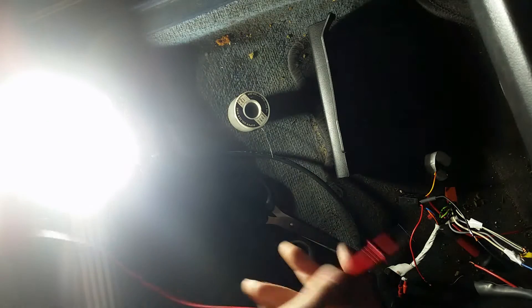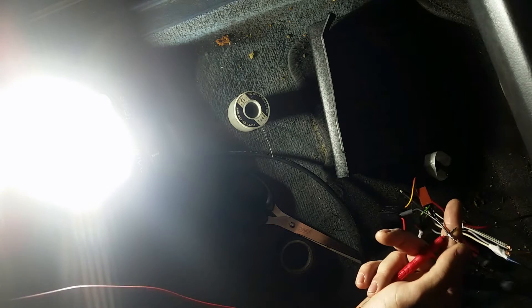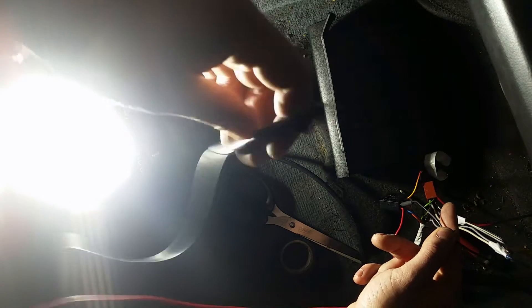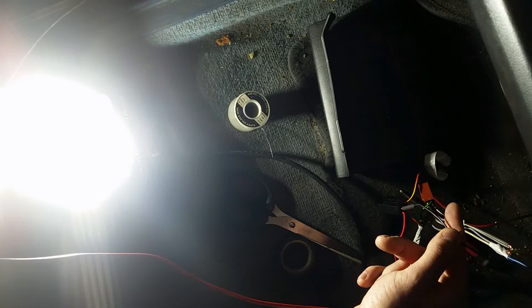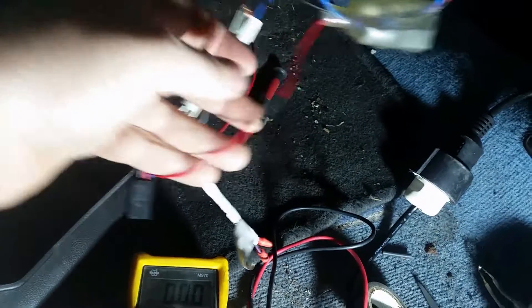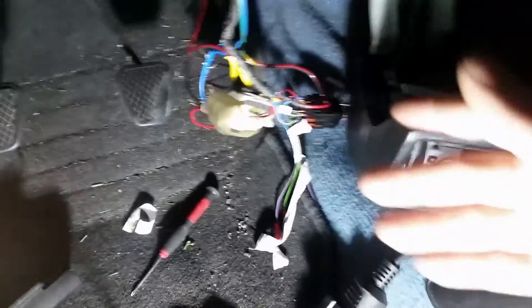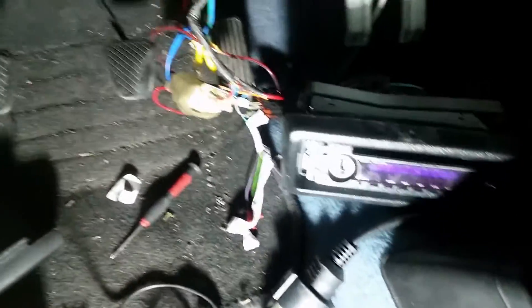Now it's time for me to solder everything up. I will not go into detail on how to do that — there's a separate video on how to solder and I'll post a link below. First up, I need to check if the ground is any good. I'm holding the probe to the ground wire and the other to the chassis — if it's correct there should be a beep. Perfect. Second one done. The radio now also has a switched power. Now I only have to get the constant power. A few moments later, I've also found the constant 12 volt wire and the illumination wire, so I've hooked it all up.